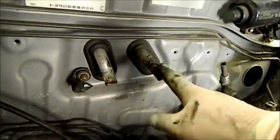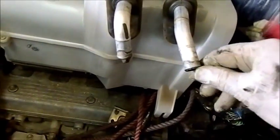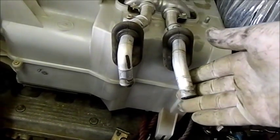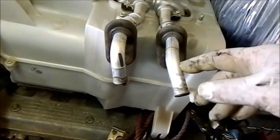Those hoses I had to cut off, I couldn't just pull them off. And if you compare that to the ones off the other car, and the other car had done 150 odd thousand Ks, they're absolutely perfect. Those hoses just pulled straight off. Coolant was nice and red, the overflow bottle was clean, just flushed it out with water and it was crystal clear again, whereas this had a lot of sediment.